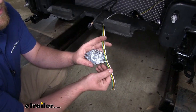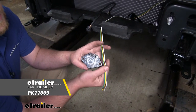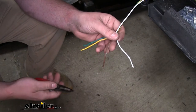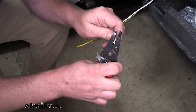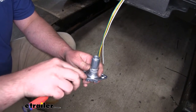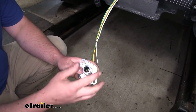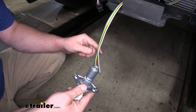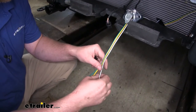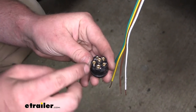Now in most cases when it comes to flat towing a vehicle, most setups will require the use of a six-way connector like this. In our particular application, that's exactly what we need. I'm going to first start by stripping our wires back a little bit and peeling back some of the insulation. Next, we're going to remove the set screw in the housing so our terminal can come out, open up the lid, and poke that terminal out. We'll take our housing and run our wires through it.